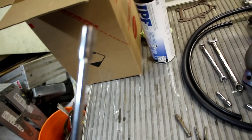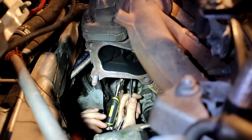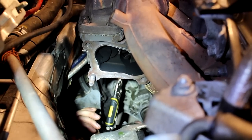Like a quarter inch. We get some seepage, but it shouldn't be a lot. Most of the oil is in the block right now, not the pan. Now, as you can see, there's the oil return line. I'm loosening those two 8-millimeter bolts. Now I'm going to loosen those, and then we are going to loosen that bracket right there. Disconnect that bolt, and that bolt.